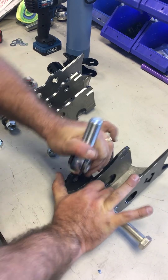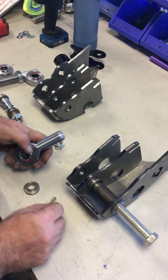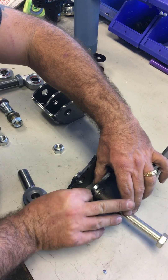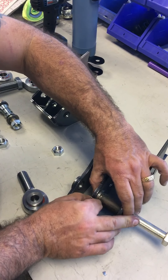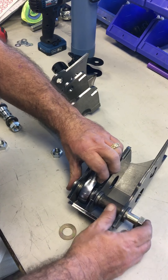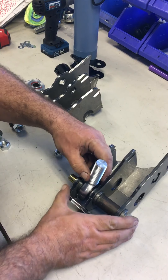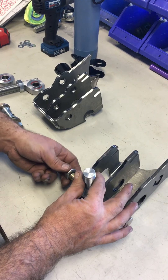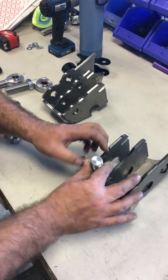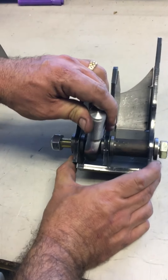Depending on if you've shrunk, you could take that washer out and not use it if you don't need it. In this case, because our spacing is right, we're going to do this without the washer. That's our heim tie rod set up so that we have a 5/8 pass-through bolt. We use a fine thread grade 8 bolt with a fine thread locking nut — not a nylock, but a Stover style top lock. That's how the driver's side assembly looks, with very low misalignment for low flop in our tie rod.